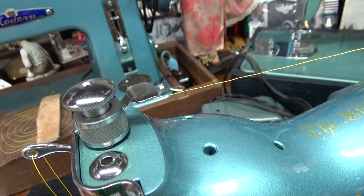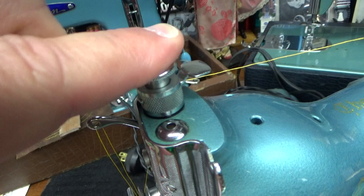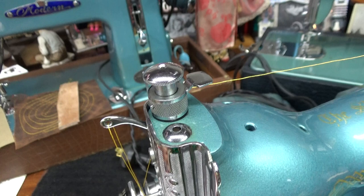And then as we're sewing the heavier stuff like we just did with this elk hide and this saddle grade leather, we're gonna go max. So we're gonna push it all the way down like that, okay? But if we're sewing the more delicate things again, we'll kind of back that off. We'll pop it all the way up, and then it's a little bit of a spitballing game to some extent, but as you're sewing the more delicate things, just know that you want to back off that presser foot pressure a little bit,